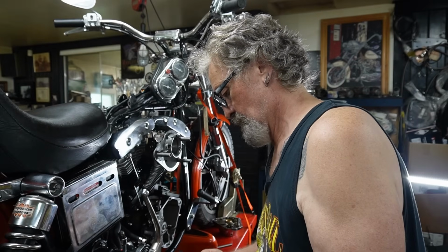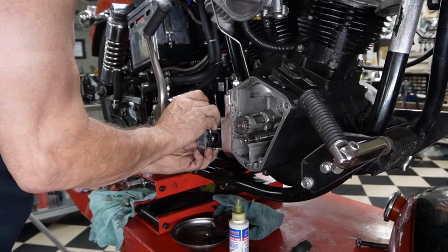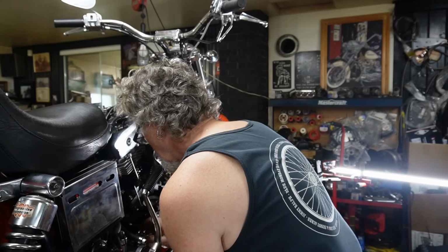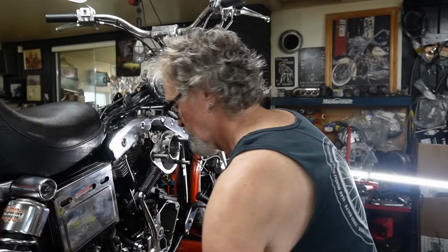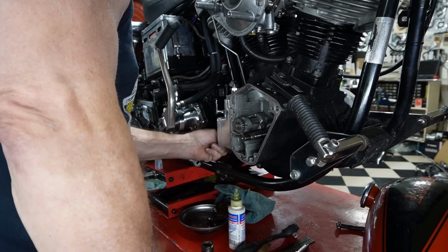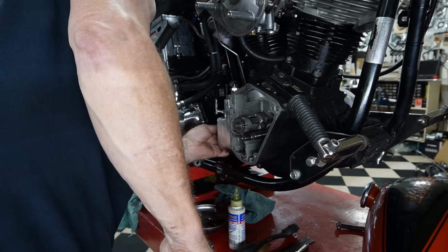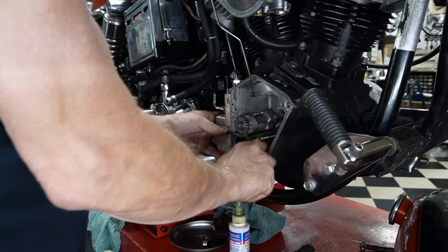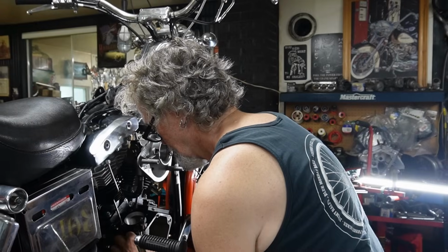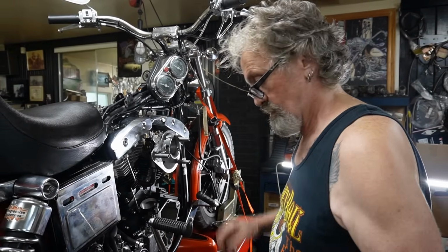Now we'll move ahead, get these two in there, making sure you got your washers on there. And we'll just start that in place. Rear one's in. They should slide right in if you're in the gasket holes. Now we'll just make sure our oil pump is in a happy place. And we'll start snugging the 4 of them up on the outside.